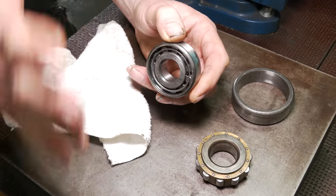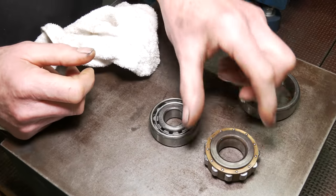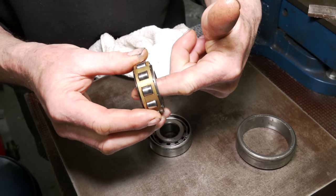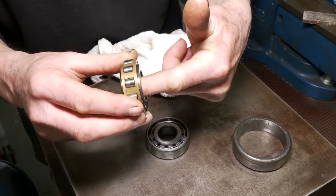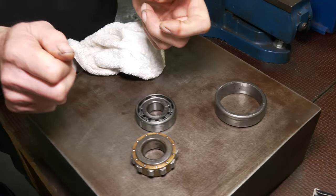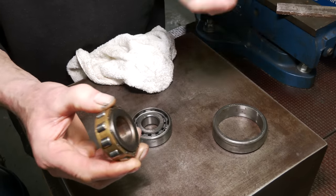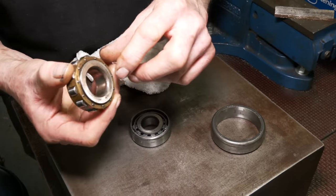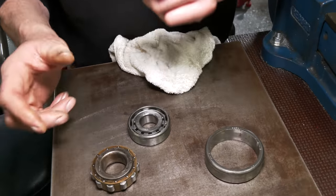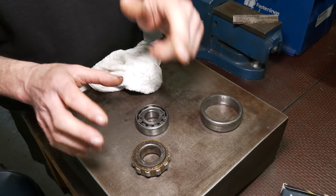Old bearings, if they've been lubricated and always been changed, they shouldn't wear. On the Norton in question, it wasn't the bearing that was worn — it was the crankshaft. When the bearing was put onto the crankshaft there was a little bit of movement, scoring a few marks on the crank, and at some stage the bearing probably started turning a little bit. All I'd done was cleaned up the crank and put some Loctite. So it had a little bit of Loctite put around the bearing, then it was put onto the crankshaft. That's a normal engineering thing. If you find a bearing is a bit slack on the shaft, a little bit of Loctite bearing retainer put in place — it won't move.